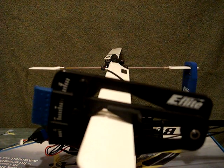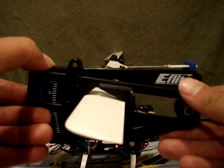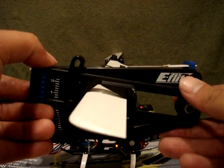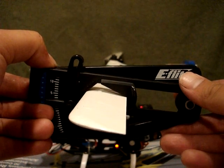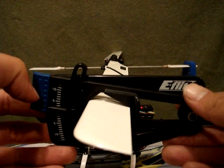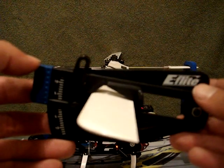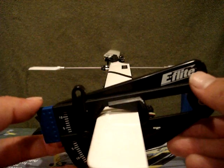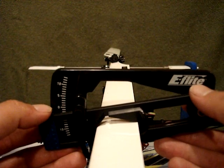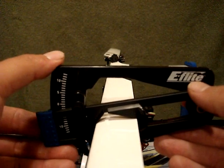Now you want to check for positive. Throw your collective all the way up, just move it until you line up. That looks like I'm sitting at nine — I may have to redo my head here, but that's how you check the high side. Now check the low side — it's just the same thing. You line up the same parts, and that's how you read your gauge. That one gave me ten, so that means my swash plate is off. But that's how you use a pitch gauge.